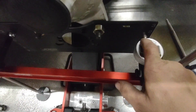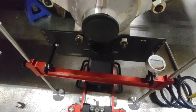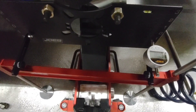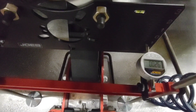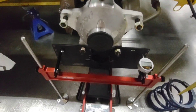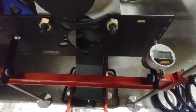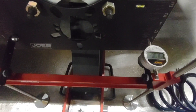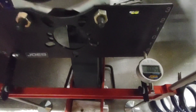We'll re-zero that. Got it back on zero — let's see how our change affected things. I can already tell you it's a lot better. It looks like since we're going to a positive number we may have actually gone too far up, but we had so far to go I felt like take a big swing at it. There we are — 30 thousandths out. Obviously I can get some of that back, so I'm going to make another small adjustment and pull that down a little bit. Back to zero, let's see how it goes. Sometimes these things swing toed-in and then swing back toed-out, and you can see it goes toed-in — thirteen, fifteen — then starts coming back. At four inches we are back to zero and heading back out.